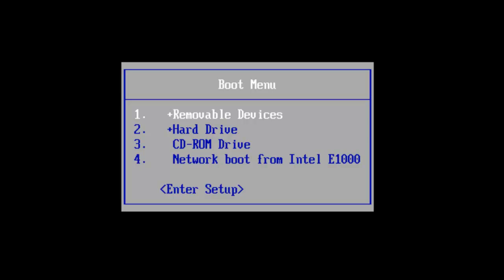But most of the time when you want to do a complete image copy, you don't want to boot up off the hard drive. That's because certain files will be used and mounted on the drive that therefore cannot be copied. So you can't get a true, complete, perfect copy of a hard drive unless it's powered down. You can't be running an operating system off of a drive, have it booted and running and accessing the hard drive, and make an exact perfect image copy.